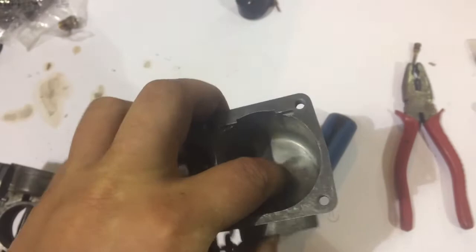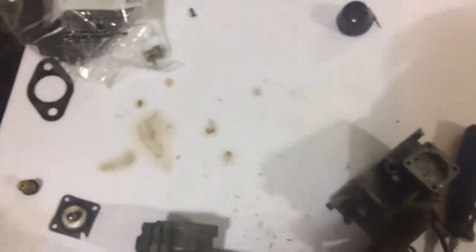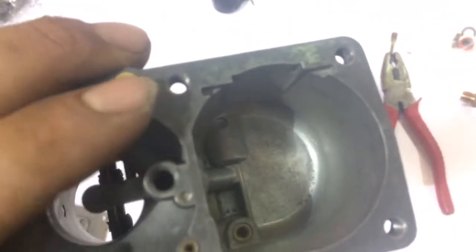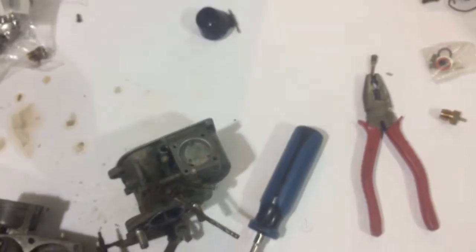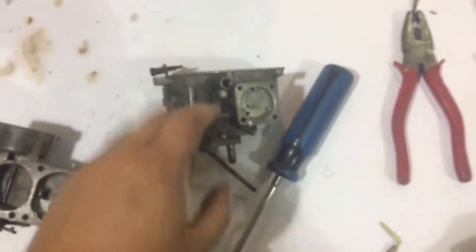Like this bowl — I still need to get a little bit cleaned out, but for the most part that's not too bad. Just spray your carb cleaner. Don't have to get anything expensive or fancy. Just spray it through everywhere that any type of fluid or air may travel through. Once you get everything cleaned out, I did have to use a little thin wire for one piece, but for the most part everything's going to work out fine. They do sell compressed air kits where you can blow through it, and they sell buckets of carb cleaner where you can throw all the bits in and get it crazy clean. But this isn't going on a show car — we're just wanting to get it going down the road.